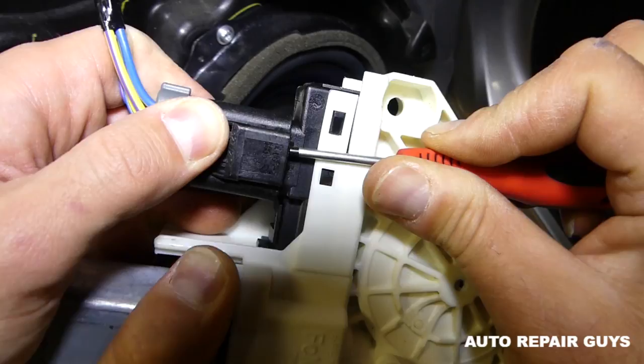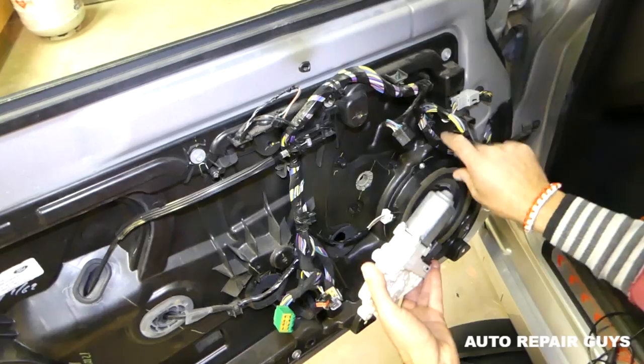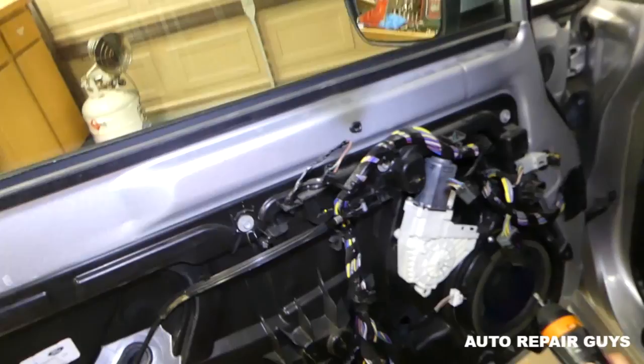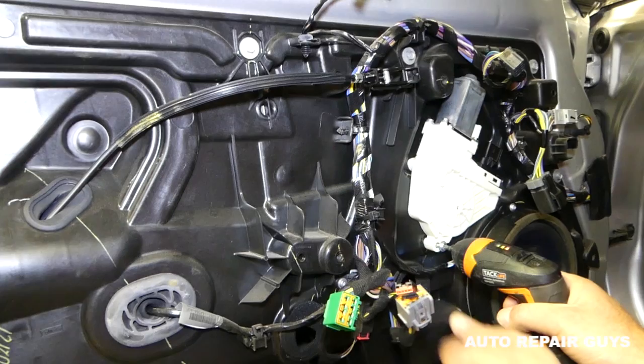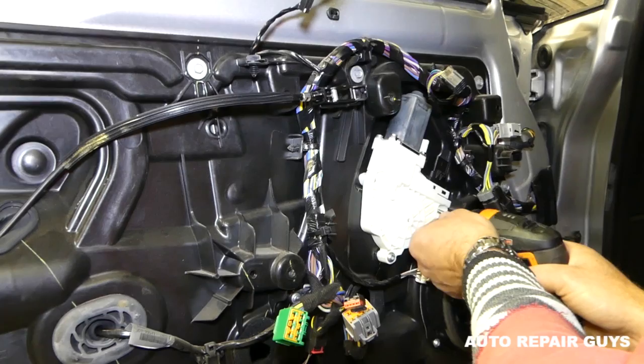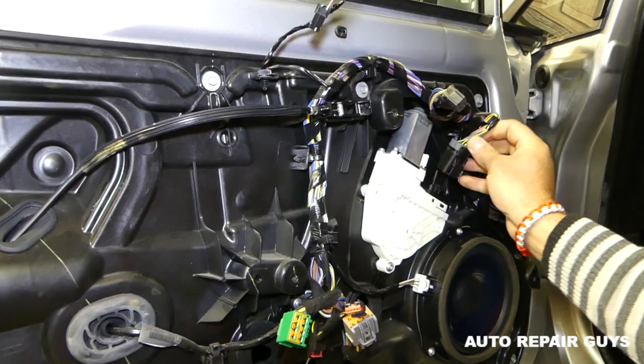You can see when you press, that thing moves up and out. That's the old motor right here. We got the new motor already — you need to get the teeth in there, and you might need to turn it a little bit to adjust so all three screws can get in. Get them tight but don't over-tighten, because you might crack the plastic. Then connect the wire, put the door panel back together, and that's the whole procedure. Thank you guys for watching — please subscribe and see you next time!